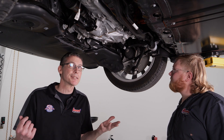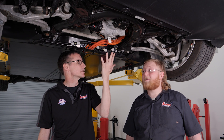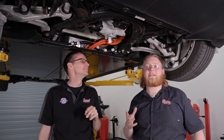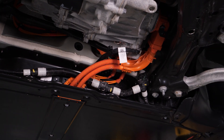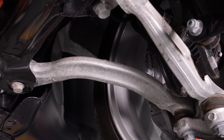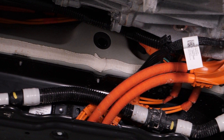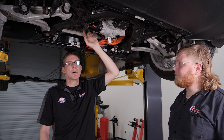Here we are at the front of the car. We've taken the aero panel — the tray, whatever you want to call it — off the front, and got an oil filter. Not only does it have one oil filter, but it has two. That's simply an oil filter to filter the oil in the transmission, because it has no engine oil. So this one's a little bit more exciting than the back. There's a nice big beefy sway bar up here, but still conventional lower control arms, normal axles, normal coilovers up front. Where it does get interesting, we have these huge battery cables back here, and we're going to go ahead and pull the frunk cover off and show you a little bit about what's above it. The water pump is actually sending water down through these hoses here and going into the front of both cells, traveling to the back.